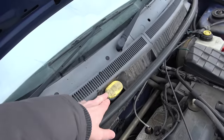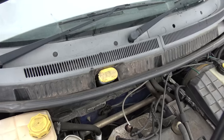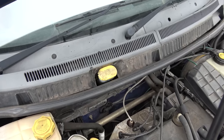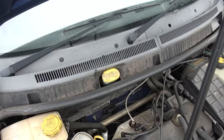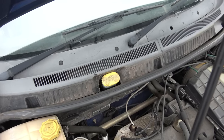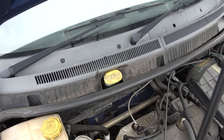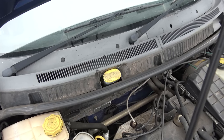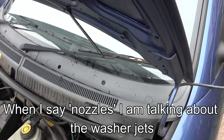This is where you fill it up and you can see it's all hidden away under there, so all of this is going to have to come apart. We're thinking it's going to be either some sort of blockage or a motor issue. There's definitely power getting to the motor so it's probably not an electrical problem, but if we can get the motor out we might be able to sort out the blockage, or test the motor in a bucket of water with a bench power supply.